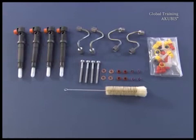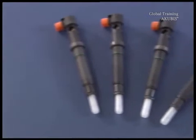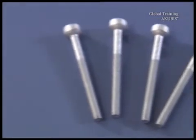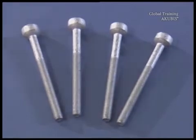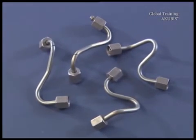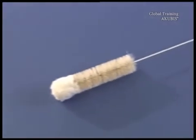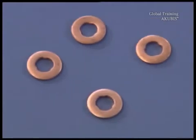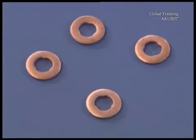Now for the parts set. It's available in EPC from the 4th quarter of 2011. The kit includes the injectors, new screws, new high pressure lines, a round brush, and four sealing rings and housing caps for the injector connectors.